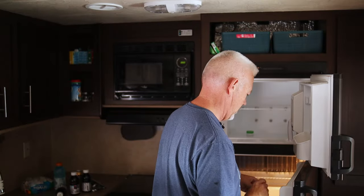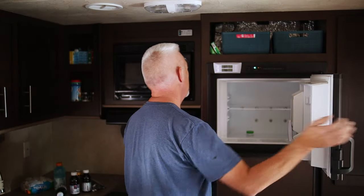I'm going to put these sensors — which are in waterproof containers — back in the refrigerator and freezer. I'll show you the statistics later in the video that let me know how my refrigerator is actually working and if it has a problem. So the easy part is done: the refrigerator is turned on, there were no electrical problems, the light was on, I checked the thermistor and it was in the middle which is a good place to start. I put the temperature sensors in, shut the doors, and now the cool-down process begins.